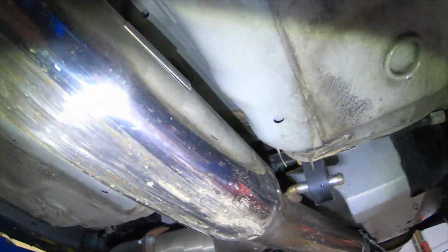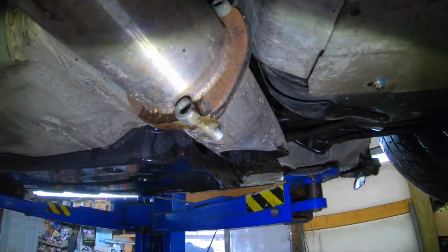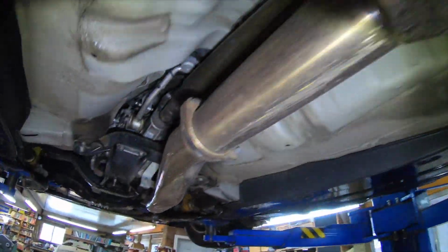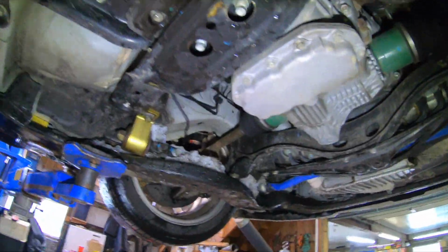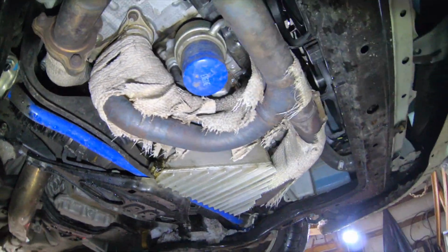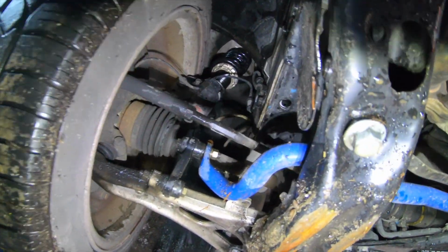So some rubbish from how low the car was. We've got some bolts that are about to fall out of this dump. It's not actually an electric cutout like I had thought. And it's a 3-inch exhaust, not a 4-inch. Got some aftermarket subframe mounts. This pan, as we noticed before, the header wrap is completely deteriorated under here, but pretty cool stuff.